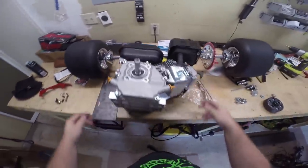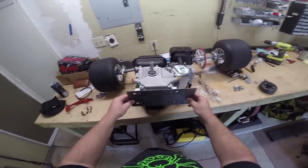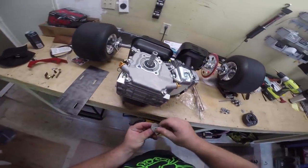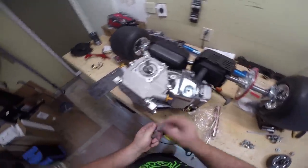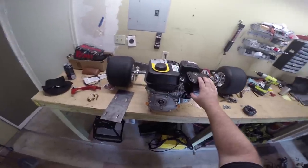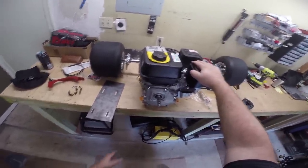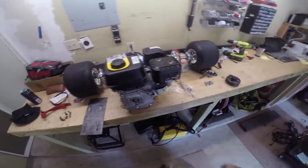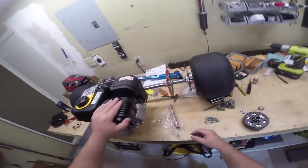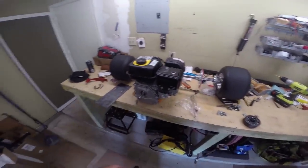As far as mounting goes, I hope these are oil drains which will make life a little easier. I bought this mounting plate for about six bucks and picked up these bolts — I know they look sort of dainty but they are actually the right size. This motor makes about 6.5 horsepower stock and about 8 pound-feet of torque at 3600 RPM. When we remove the limiter from inside this cover it'll jump up to about 7 horsepower and 9 pound-feet of torque at 5600 RPM, which is where you start getting valve float. If I spend $150 on a hop-up kit I can get about 11 horsepower and 10 pound-feet of torque, but that's probably too much for the drift trike, so we'll leave it stock for now and upgrade as needed.